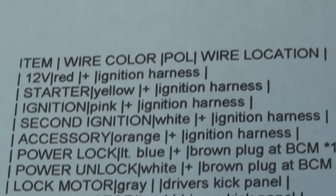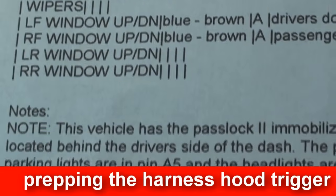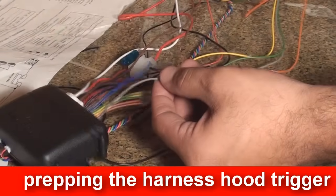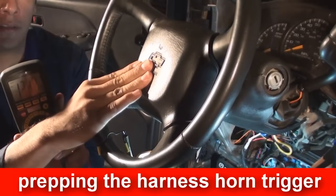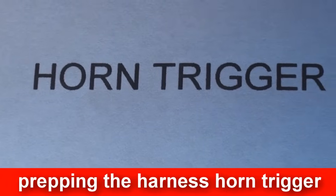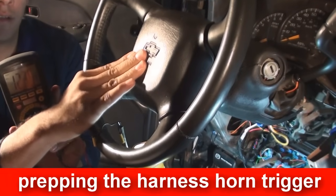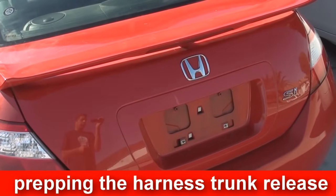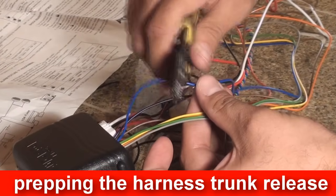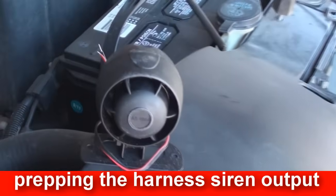Look at your tech sheet. Does it show that your vehicle is equipped with a hood or trunk pin? Some vehicles do not have these pins installed from the factory. If they do, or if you plan on adding a pin switch later, keep this wire. If not, cut the wire off. In an alarm, you can use a horn to sound the alarm instead of a siren. If you plan on using the horn, keep this wire; if not, cut it off. Usually the horn is connected to save money on the cost of a siren. If your vehicle does not have an electric trunk pop or you do not plan on adding one later, cut this wire off. If you are using a siren to sound the alarm, keep this wire; if not, cut it off.